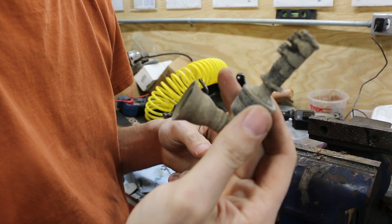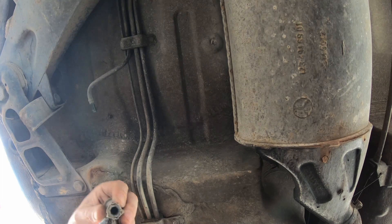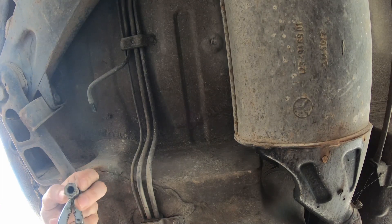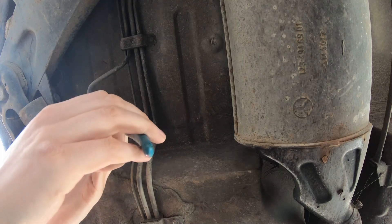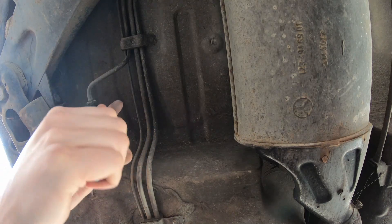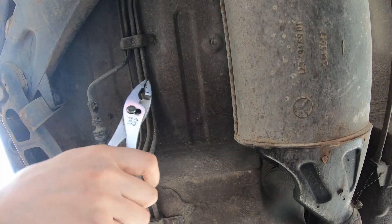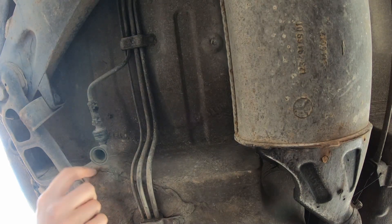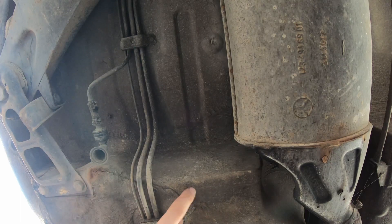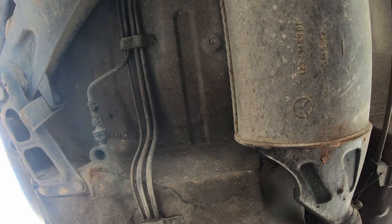Let's go stick this back on the car and see if it solves anything. We can put our freshly destroyed check valve back on - now that it's no longer a check valve but a coupler - and I will look into replacing that. But in the meantime, let's get our clamp back on there. Now our tank will actually be venting. I'm also noticing I've got a little bit of rust repair to do under here - these floor pans right at the back corners, especially if you've had any water intrusion issues like I did.